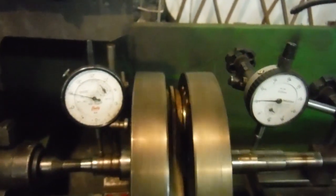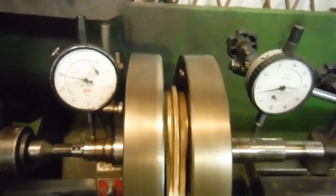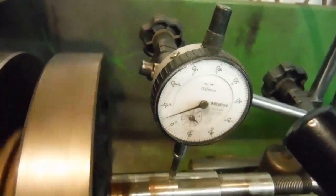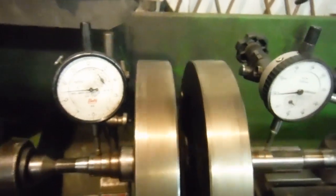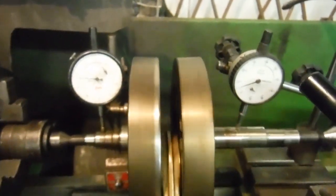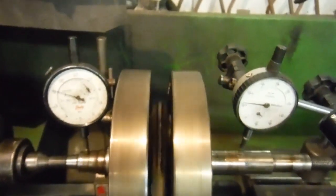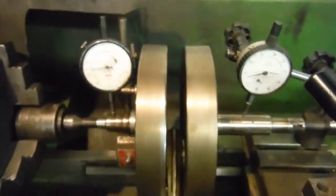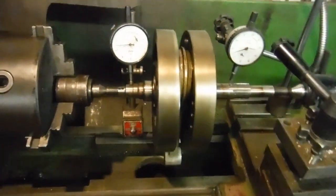We can see that the needles are rising and falling together, quite remarkably, damn near the same amount. That one there probably equates to about 3 thousandths of an inch. Actually, I would say that one does as well. And the good news about all that is that they're rising and falling together, so one even cancels the other one out in real terms. So that crankshaft, we can say, had no run out, which might be part of the reason why it managed to do 80,000 miles perhaps.